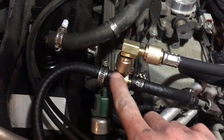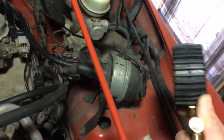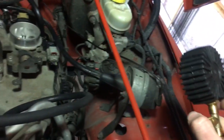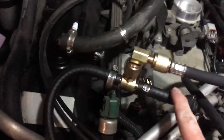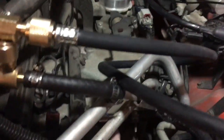I didn't have the T, so I rented a kit from O'Reilly's that had the T in it. That goes to this 90-degree fitting into the pressure gauge, which is part of the rental kit. I already had this tool — I just didn't have the T or any of the other fittings. Out of the T, this comes back around and goes down to the actual fuel rail.